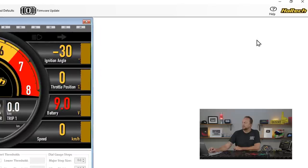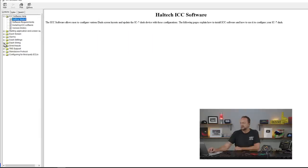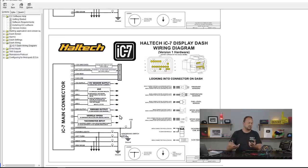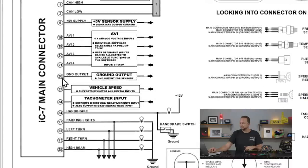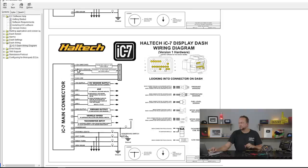One thing we might do first — go to Help, ICC Help, then over the side here, Dash Wiring, IC7 dash wiring diagram. Just in case you've lost the paperwork for the dash, if you've got the software on your laptop the wiring diagram is available under that help button. Looking at the diagram, I've wired the ground for the GPS sensor into pin 30, the output into pin 33 which is labelled vehicle speed, and I've spliced the power supply into the same supply that controls the dash — pin 3. I know I've wired it correctly because the light is flashing on the GPS puck.